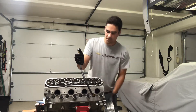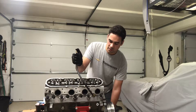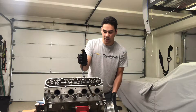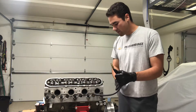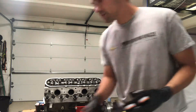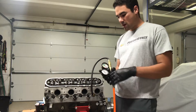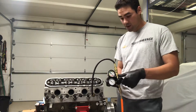So we're going to start rotating. There's exhaust closed — you can hear pressure coming out of this little tube. Now I've stopped feeling pressure being blown out of this hose. I'm going to go a little farther — now I feel pressure being sucked in, which means the piston is on its way back down. So we're going to reverse and split the difference. It's kind of a guessing game to get it perfectly on top dead center. If you have a degree wheel with a pointer, that's how you can do it precisely, but I don't have that, so we're going by feel. Now I'm going to grab my air hose from the compressor, plug it into the gauges, and slowly start to feed pressure. If we went too far past top dead center, it'll just want to roll the motor over and we'd redo the process.